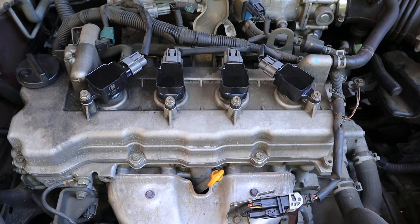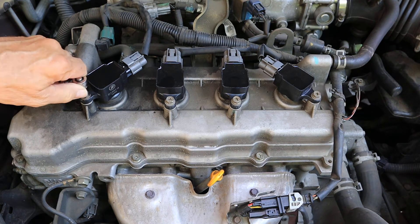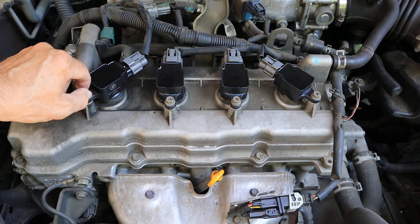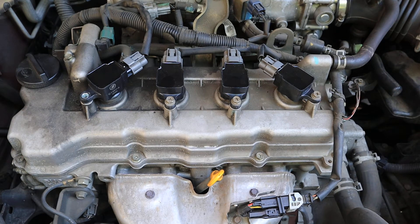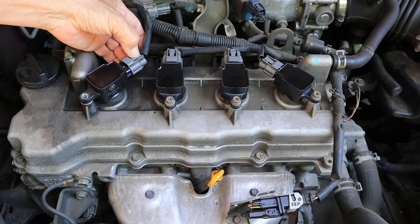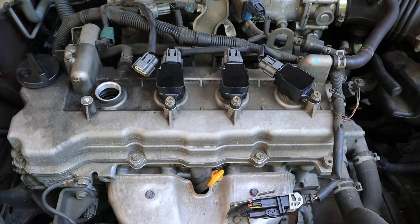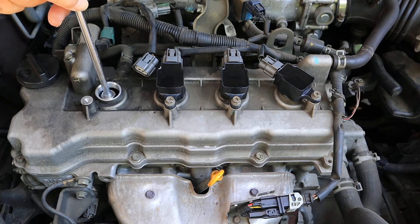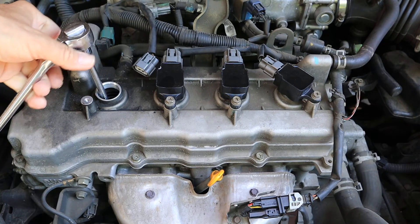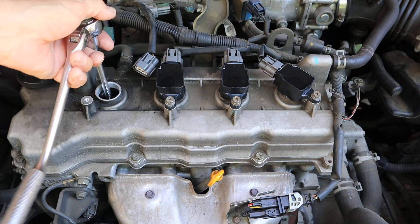How do you do the repair? First, take this bolt off. You can use a Phillips or a socket. I prefer a socket because you will not strip out the head of the bolt. Then disconnect this electrical connector — just press down on this little tab here. That comes off, and this is your coil, and your coil comes out. Then you take your spark plug out. You'll need a small spark plug socket, an extension, and a ratchet to remove the plug. You don't need a fancy spark plug removal socket — you just need a ratchet.